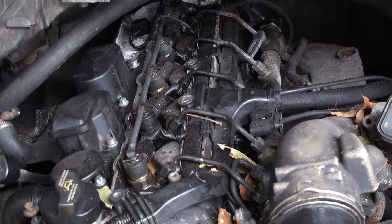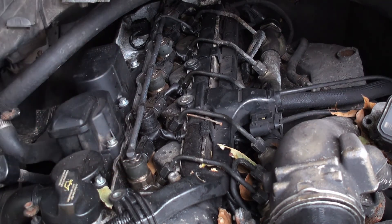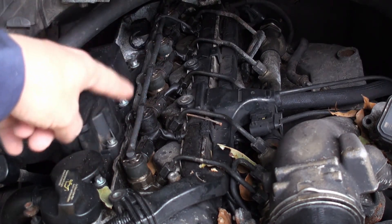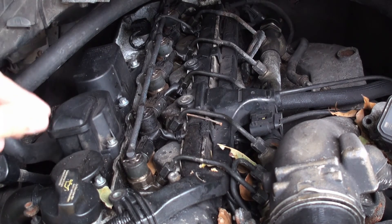I'm really sorry for that barking — it's not my dogs, it's my neighbors. If you have a fuel leak and you can see something leaking towards the back of the engine near the transmission, it could be your return fuel line leaking. There is a hole at the back of the cover with a little pipe that goes towards the back between the transmission and engine, and it basically leaks diesel from there. You can see that happening especially if you just messed with fuel injectors and possibly damaged one of the nozzles — even though it's a return fuel line, you're gonna have a lot of problems and most likely won't be able to drive it.